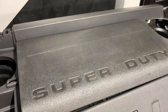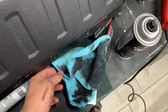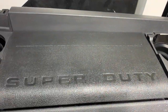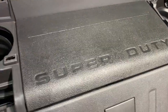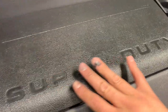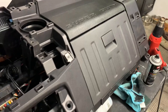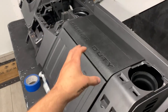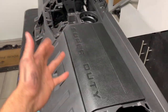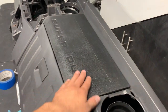Usually after you do my little trick with the rag, the reason I do it with the rag is because I want the thinnest coat on here. I just want a little bit just to get over that mess that was on here - I don't need a full coat, I just need a little bit of stain, basically like staining wood. But I noticed it's pretty shiny compared to the rest of the dash - especially sitting at the driver's seat you look over, it's definitely a lot shinier than everything else. That's how you can tell when people spray paint their dashes - it doesn't look right because this black is flat or matte and spray paint always looks too shiny.